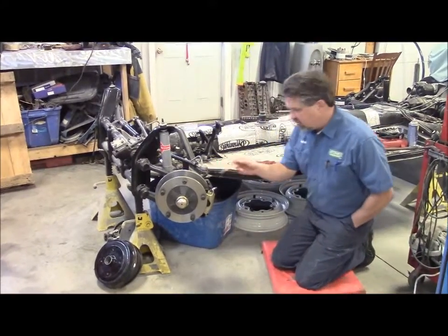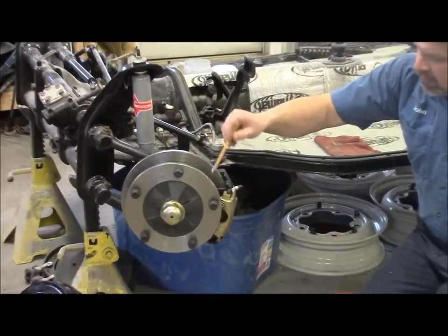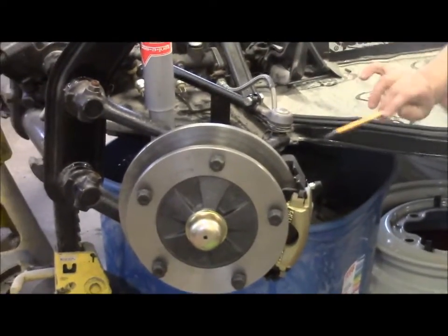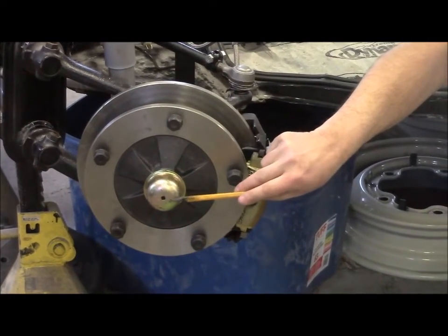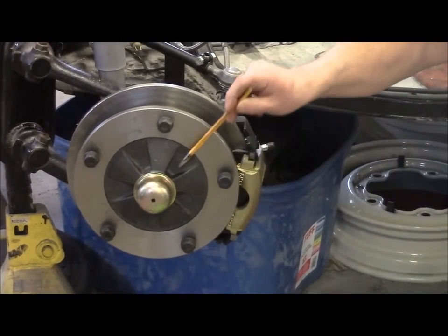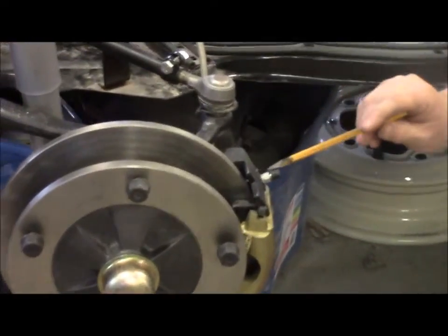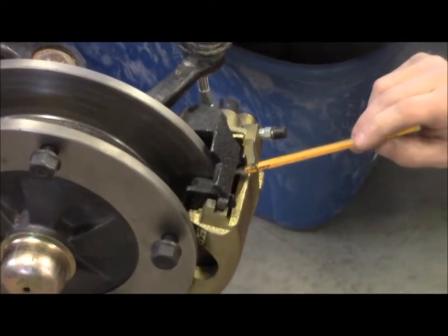So now we'd just like to show — this is with the kit installed. We're converting it from a four bolt to five bolt, so we have this five bolt setup for an older style look. The beam has been replaced along with the chassis. We have the new rotor, and underneath the cap we have all the new hardware: the outer bearing, the new rear bearing and seal, and this new caliper, which comes with the caliper housing, backing plate, and pads.